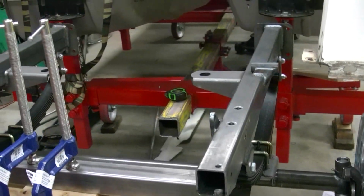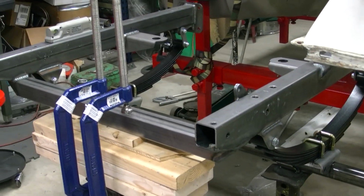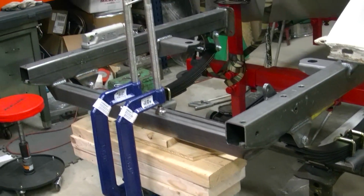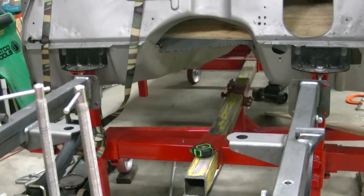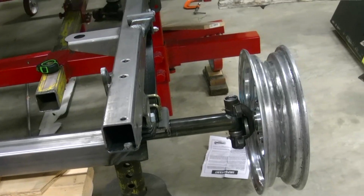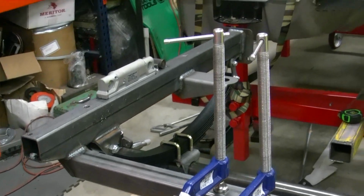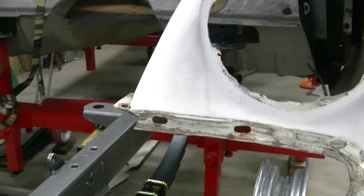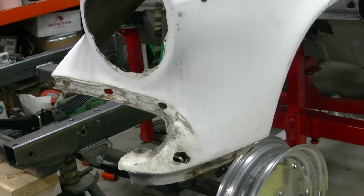Okay, we've now got the Speedway axle assembly, Chevy 2 gasser assembly, whatever you want to call it, just put together, getting it sized up and finished, matching the frame up with it. Where it's setting now will give the car approximately a 2-inch higher stance in front than the back. That's running a 28-inch tire on the front and 31-inch tall tires on the back, which should give it just about a 2-inch higher nose stance in the front, which is what we were after.